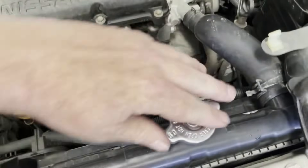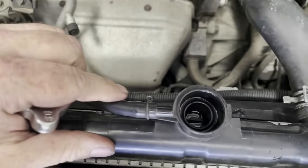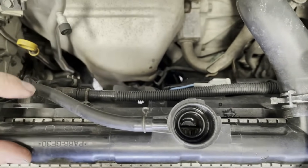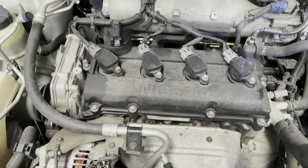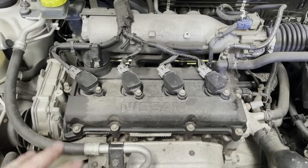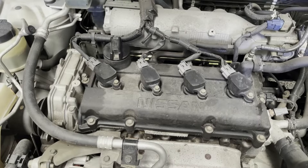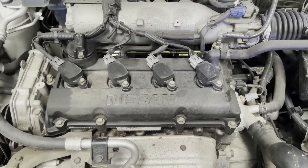I'm also noting that I've got no oil in my radiator at all. Now if you have an oil cooler, sometimes you get oil mixing both ways. So before we go any further, I'll just do a quick compression test to make sure things are okay, rather than spending the time and energy on it and then finding bigger problems later on.